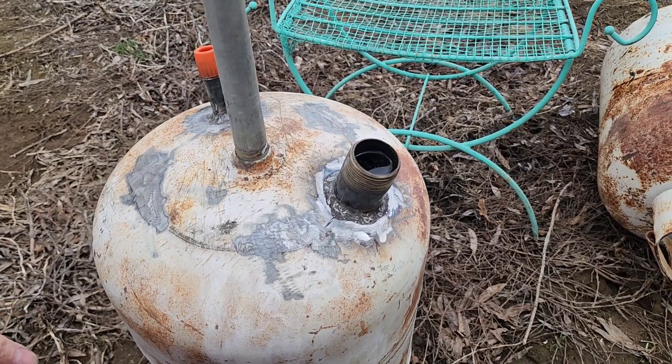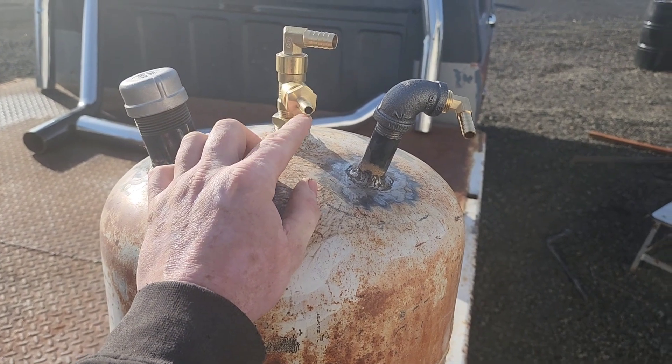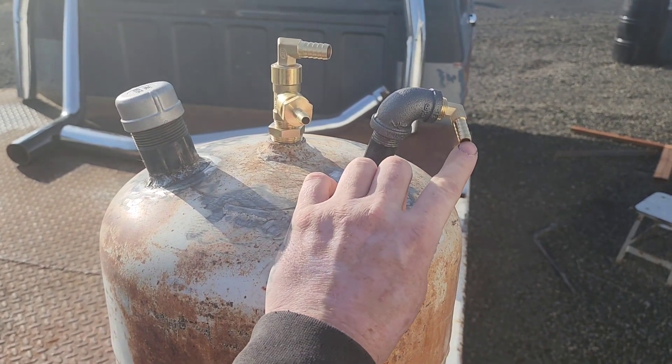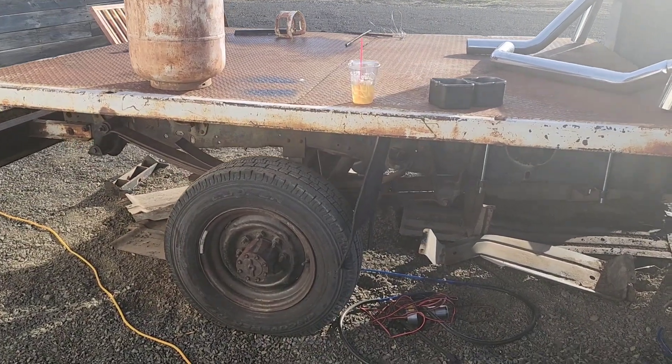Looks like we were successful in turning this propane tank into a fuel tank. We've got the filler neck, we've got the return line which is 5/16ths on one of these 7.3 diesels, this is just going to be a vent hose, and this one is to supply the engine - that's a 3/8ths barbed fitting. If you're not already, go ahead and hit that subscribe button and follow along with this 7.3 IDI diesel race truck build we're putting together. Next week's video is going to be remounting this flatbed, and the week after that we're setting up this roll bar on the back. I'll see you next Sunday. Until then, believe in what God gave you - take on some projects, build, fix, create. Keep building, guys.